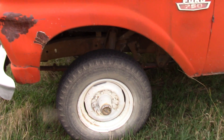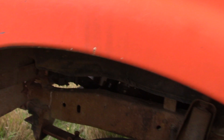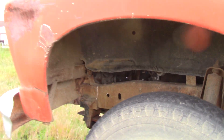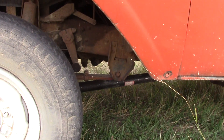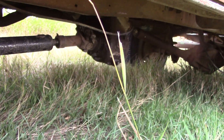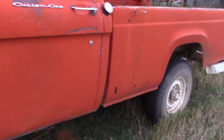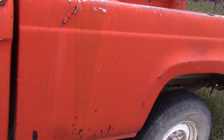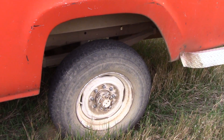I got this out of Montana. Haven't done a whole lot to it — put a new fuel pump on it. When I got back from deployment, had to go through the carburetor. It had already had a new front drive shaft on it when I got it. Had to tighten up the transfer case, and I actually have to do that again — the transfer case is loose, you let the clutch out and you can hear it rocking underneath.